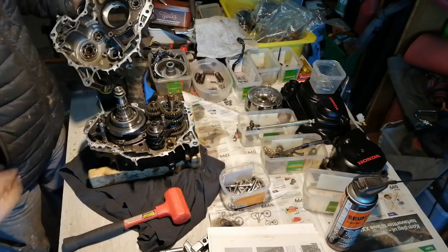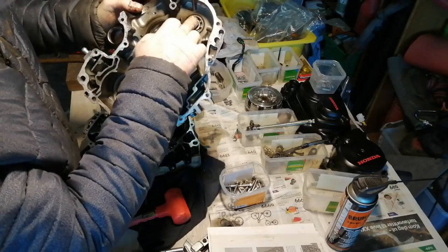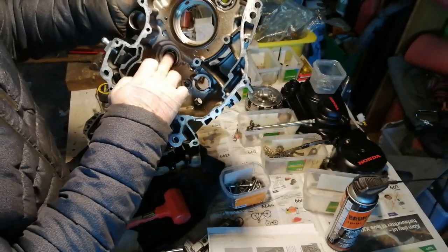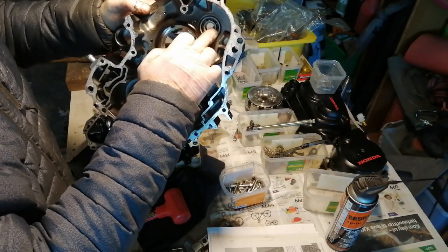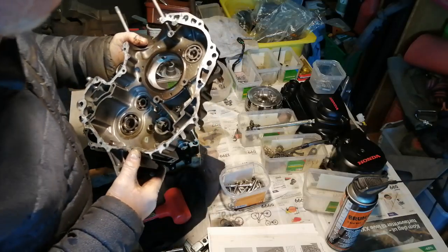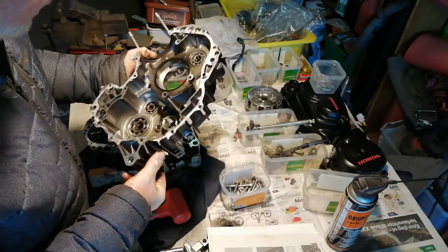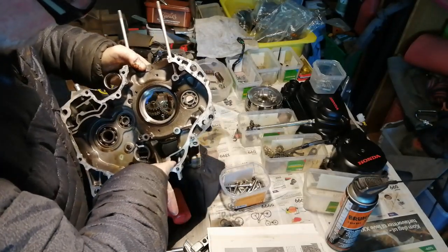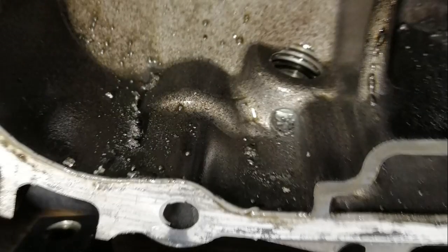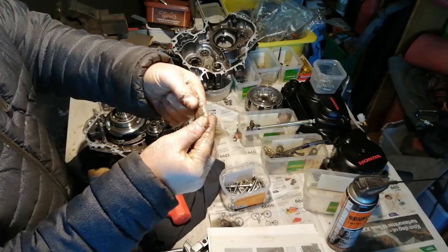And then you've got three bearings that can stay in the case. I'll just spin these out - they feel okay. That one has got crap in it. Can you see how that's rotating around easy, and that one rotates around easy, but this one is stuck. It will go if I force it, but I can feel there's little bits of piston in that one. That's disastrous - this is full. Look at that - that's full of metal. That's all little bits of piston - it's like metal grit. If anyone ever tells you that you can just rinse an engine out, I wouldn't.